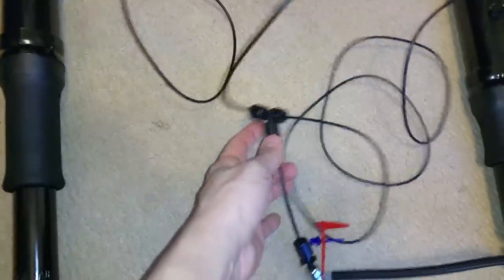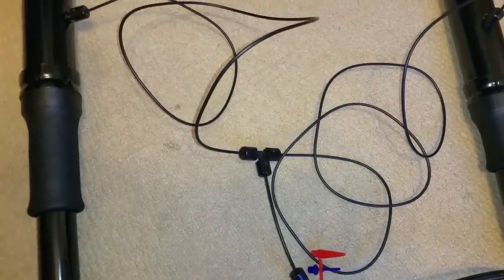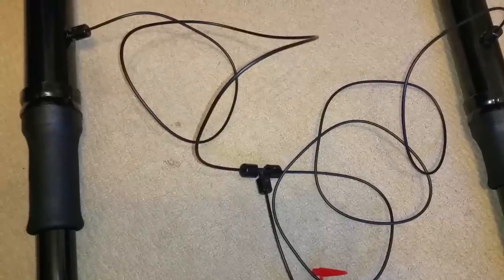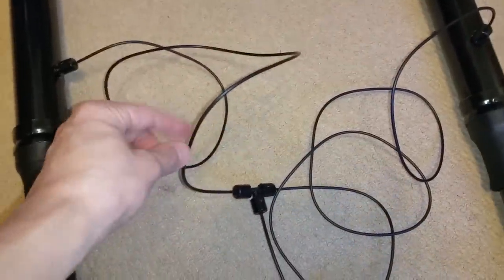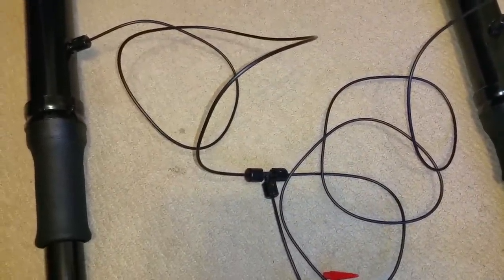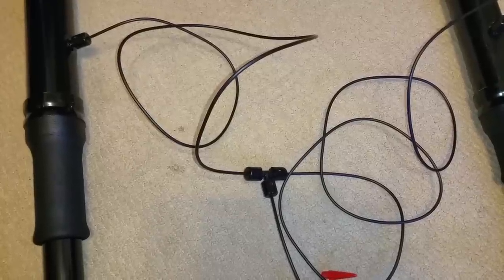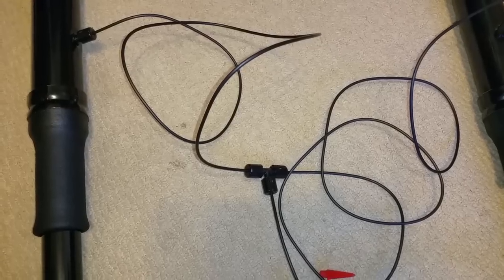Right now there's about 10 pounds of pressure in there to illustrate a point. What you basically get is this T-fitting and 1/8th inch tube — I don't know why they do 1/8th tubing, because most air spring or air shock suspension kits come in a quarter inch, which is a lot easier to adapt to. I don't know why they did that, and that is going to be a problem — I'll talk about that later on.